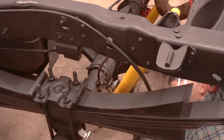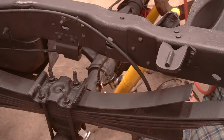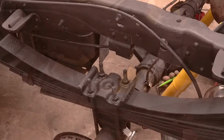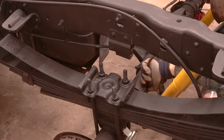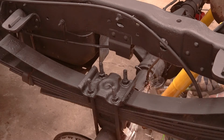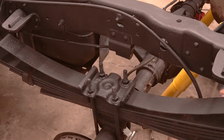Now, the problem is that the dissimilar metals of the brake line mount and the vent cause it to basically corrode weld itself together. Mix that in with rust damaging the hex, and no socket we tried would grab. Even cutting it off didn't quite solve it. We actually had to cut the metal end of the brake line and use a chisel to get that off. Now once that was done, the axle vent came out fine, albeit in pieces.